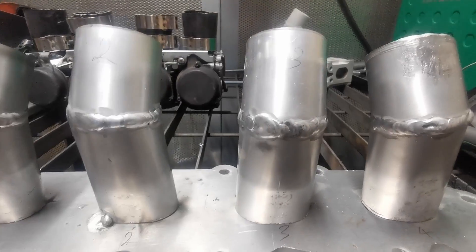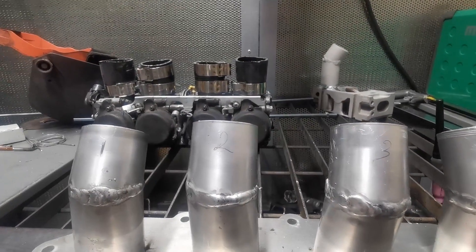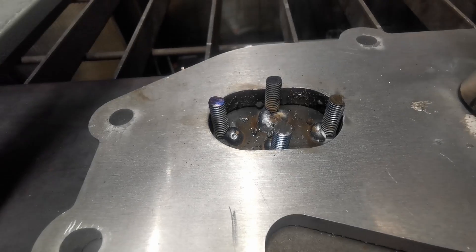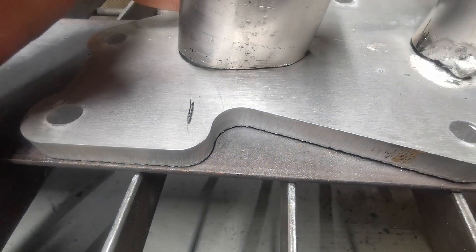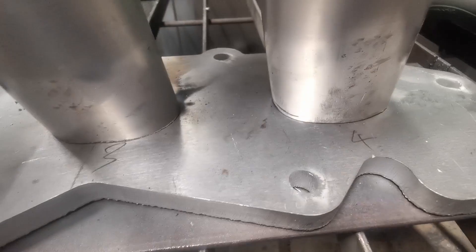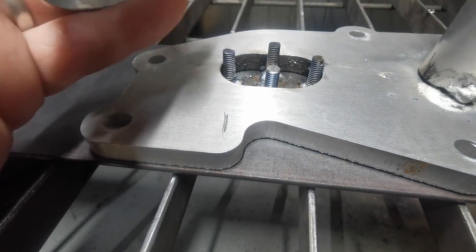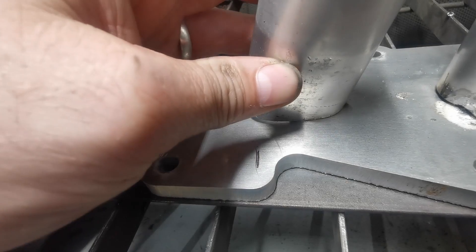What I need to do is fit them into place — they're all slightly different heights, but I'll need to adjust those heights, just cut them off with the hand grinder so they're all at the right heights and all level. Other than that, it's a matter now of welding them to the plate. To make sure I get them in the right place, I've made a little guide basically — so they fit in there and it just allows me to put each pipe into the right place so it doesn't move too much. Then I'm going to get the sandblaster out and sandblast a little bit around the edge here and up the edge of the pipe as well, which allows me to make sure the aluminium is really, really clean before I weld it on.